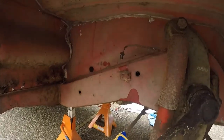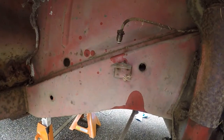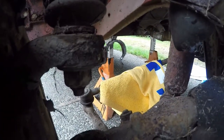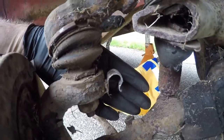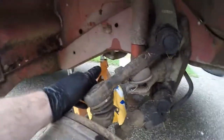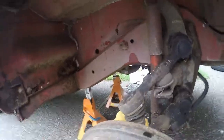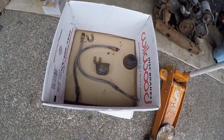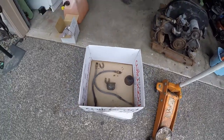So what I had to do is disconnect the hose from the hard line, and right here that little clip holds the brake line in. I had to pry that up a little bit to get the brake line free, and then I was able to disconnect it from the back. So that's the easiest step of this job — do that on both sides. Another best practice from my bug world: put your stuff in a box. Although a lot of these parts are going to get replaced, just in case you need them, put them all in one spot. So I started a little parts box.